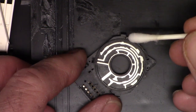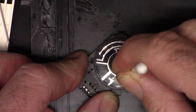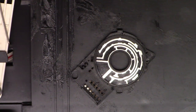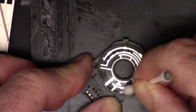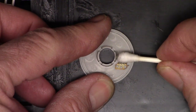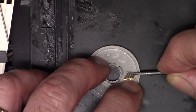Next I'm going to take a little bit of acetone on my cotton swab and just wipe it out. Now the acetone will not eat this type of plastic — it's only going to clean the conductors. You can see on the cotton swab it picked up quite a bit of contamination. I'll dip the Q-tip back in the acetone and wipe it down one more time. If this were going to eat the plastic away it would be absolutely black at this point — hardly anything came off. Now I'm going to go ahead and very slightly bend up these contacts to give them a more positive pressure.